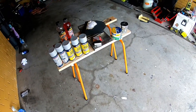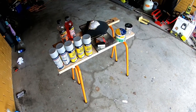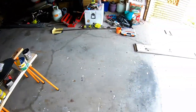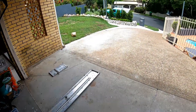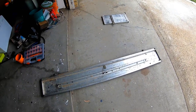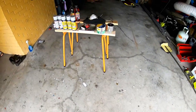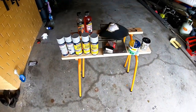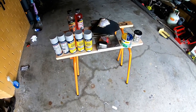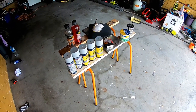Prep time — going to get the canopy and tray sides ready for the bully liner. Sand them back, give them a good clean up, use an etch primer, and that should be ready for the bully liner. Take time to do a good prep on the alloy and hopefully it adheres nicely and is long-lasting. Get all the surfaces nicely cleaned up, get that etch primer on, and then we'll get into the bully liner.